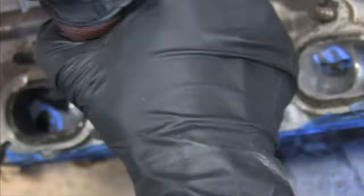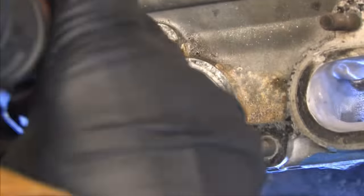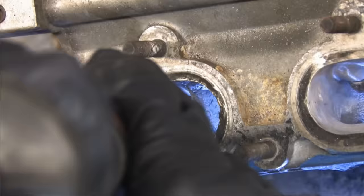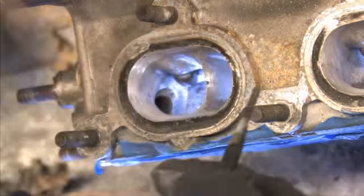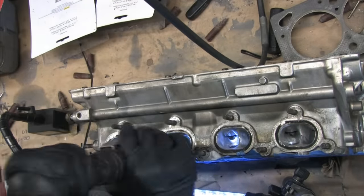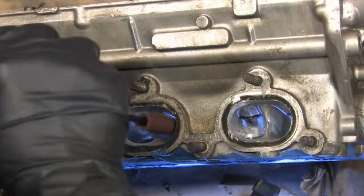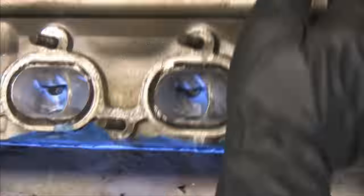A mild head port and polish done to maintain or improve intake and exhaust port velocity. The rest of the job is just smoothing out the entire port, and I'm going to put a nice bling on it, but it's nothing you haven't seen me do in this video already. It's all the same: 80 grit rolls, then 120 grit rolls, inspect your work after every grit to make sure it's even, and then move on.